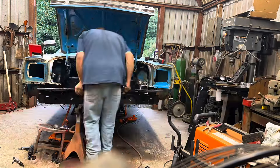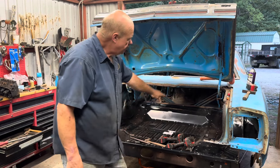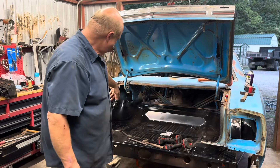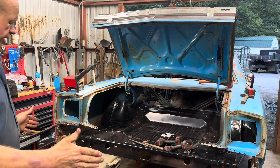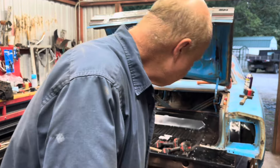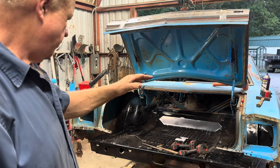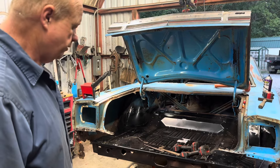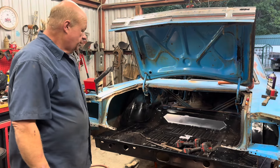We got it cut in there, almost ready to start spotting it in there. It fits pretty good. I'm pretty pleased with everything. The inner wheel wells or wheelhouses are fitting real nice. Everything looks good. Only thing is my frame is pulled about three sixteenths to one side — I'm trying to get it perfectly centered. The frame kind of moves back and forth and I got to get that right. It's close enough, we could probably live with it, but I'd rather get it perfect. So I'm going to try to pull it around just a little bit — it'll flex some. I think everything else is square with the car just like it's supposed to be. We're pretty close. I'm going to start welding it in here in a few minutes and I'll be glad to get this part done.